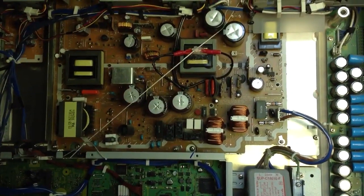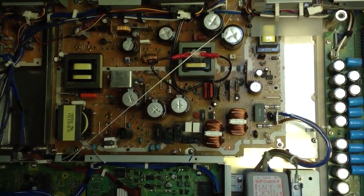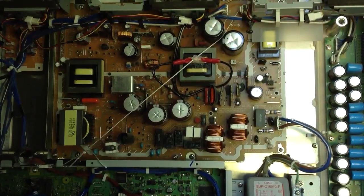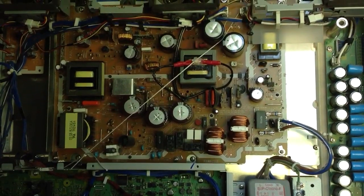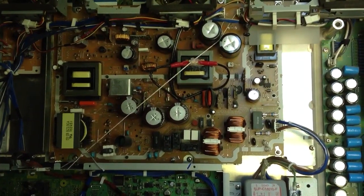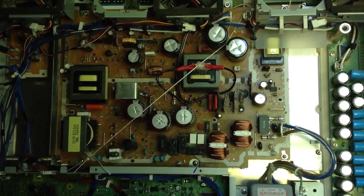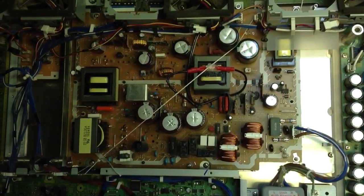This video is for a 42-inch Panasonic Viera Plasma TV. The power supply had a 10-flash red light problem in the front — flashes 10 times, power supply fails.